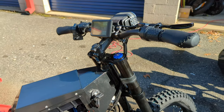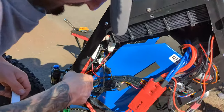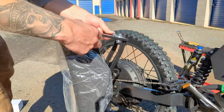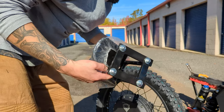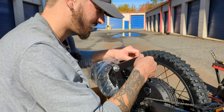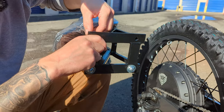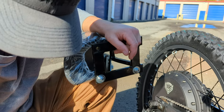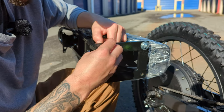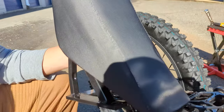I'm going to tuck this Bluetooth device back in and stuff everything back in here. Everything needs some room for the seat — it's hard to get the seat on. One bit of advice: don't drop any bolts in there, because you're beat if you do — you're not getting them out. I put a Bomber together last week and dropped a bolt down there and wasn't able to get it out. Game over. I don't use all the extra hardware it comes with; I just use one washer on each side — using all of it makes it too difficult to get the seat on.